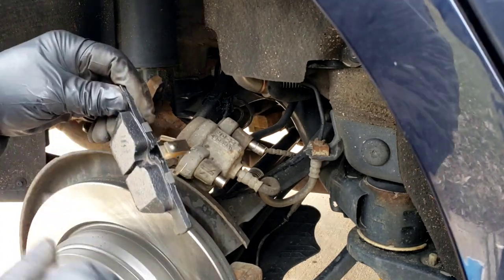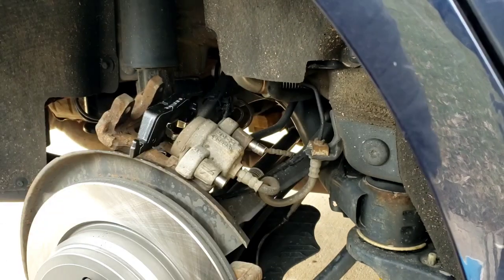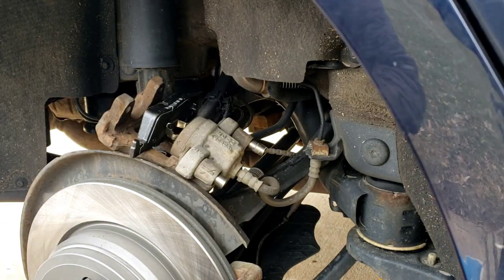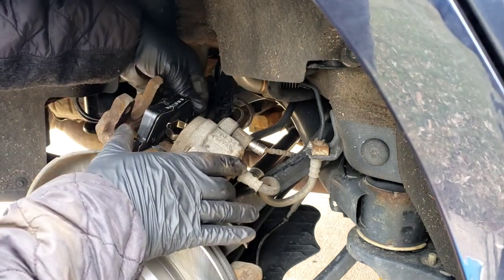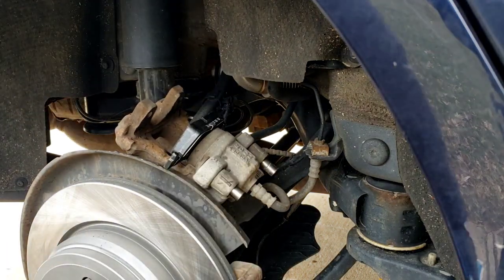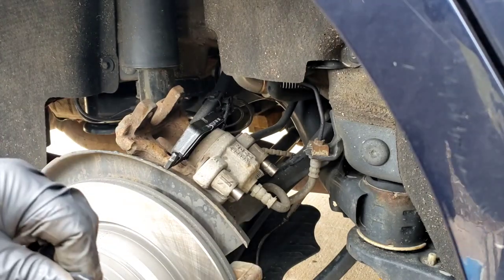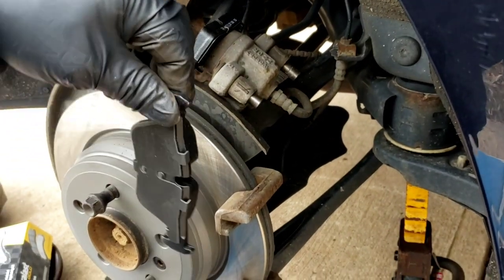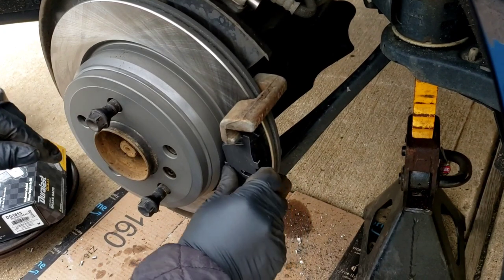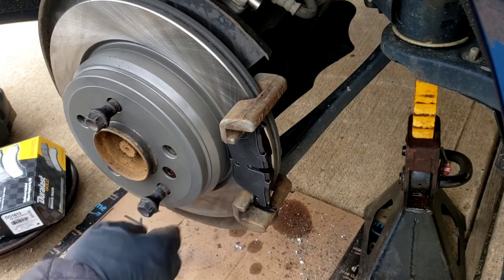Depending on certain cars, it's a little hard to get in there with the sensor, so plug it in afterwards. Whatever you do, don't touch the brake pads — got to keep them clean, no foreign oil or grease on them. Brake pad goes in nice — that should just close right in. Big difference compared to other ones where you've got to squeeze it between those metal brackets.